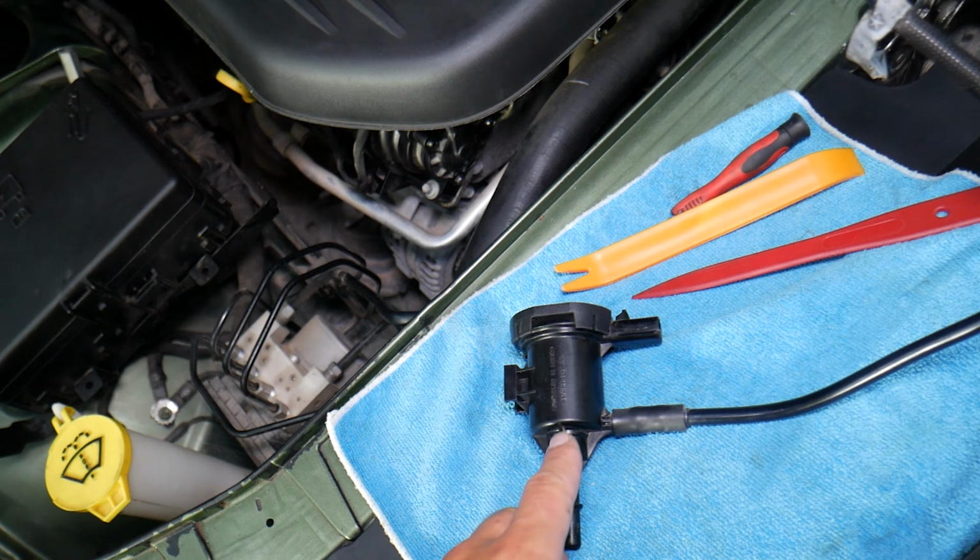Let's go ahead and remove the upper engine cover first so we can show you where it attaches. You can see on the bottom here it has one hose that says canister, and it's that hose right here. It comes from the fuel tank. Why? Because in the fuel tank, you have the gasoline splashing, it expands with heat, with movement, and back in the days those fuel vapors used to be released in the atmosphere. Just released, the fuel cap wasn't tight, there were no seals.